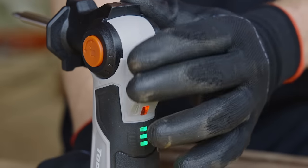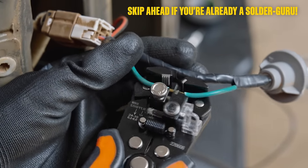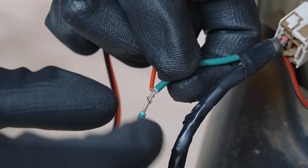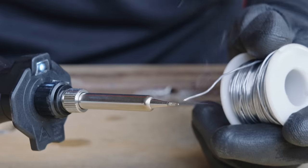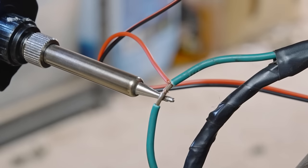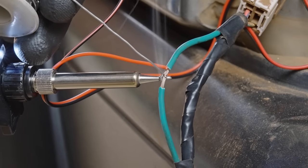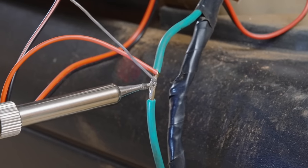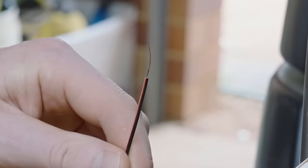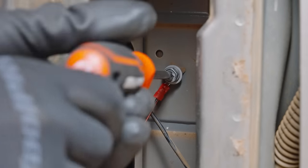It's time to get that soldering iron heated up — you're going to learn how to solder. Separate the reverse wire that you've found and carefully use the wire stripper to bare a section. Strip the end of the red wire for your reverse camera and wrap this around the reverse wire. The soldering iron should be hot enough now. Apply a dab of solder to the tip — this is called tinning. Then hold the tip to your wire join for a few seconds and gently feed a little solder into the joint. It should flow and cover the entire bared section. If it won't flow, allow the iron to apply more heat. Once the joint has cooled, wrap it in a little electrical tape. If you also have a black wire from the reverse camera, strip the wire, clip on a ring terminal and fasten this behind the nearest bolt — preferably bare metal to avoid earthing problems.